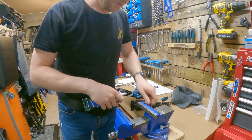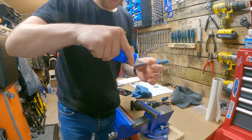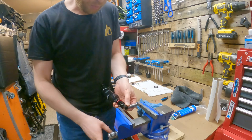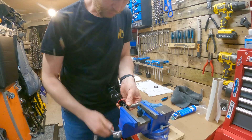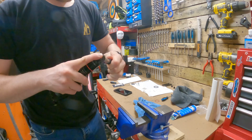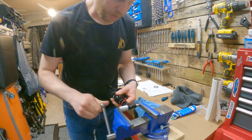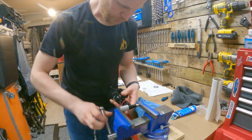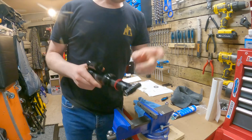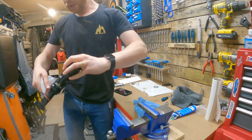To reinstall the hardware it's exactly the same as I did earlier, just in reverse order. I'm going to put a little bit of grease on the hardware just to ease it into the shock, and then use the vise to push it back in. The Trek Remedy has got different size spacers either side of it, so I'm going to put the bigger spacer on as a guide, squeeze this back in - being careful not to go too far - and fit the other spacer on the other side. Before I fit it to the bike, I'm going to give the shock a good clean with isopropyl alcohol, just to get more of my greasy hand marks off it.